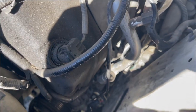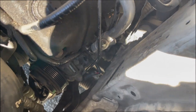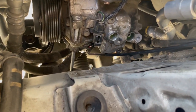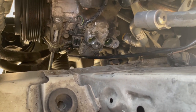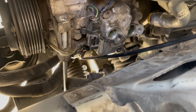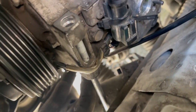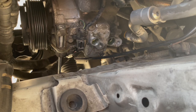On the top one, we just took a 10mm ratcheting wrench and removed all of our connectors and our lines. We got our last bolt out up top — it's a little tricky and basically a pain in the ass. But if you maneuver your compressor just right, you'll be able to thread it out enough to get it out, even past the subframe. Our compressor is all the way out, so we're going to remove it, compare it to the new one, and pop it back in.